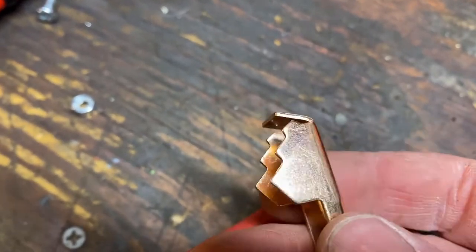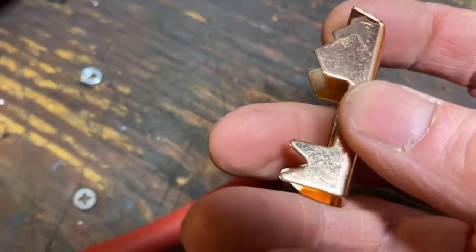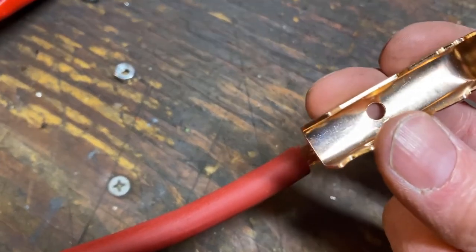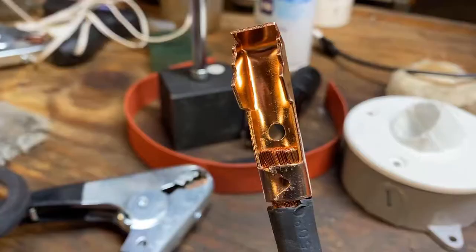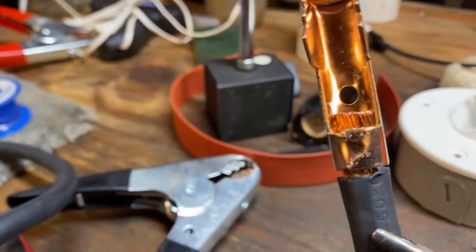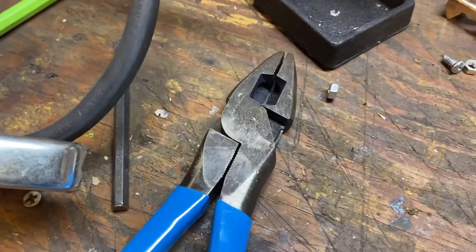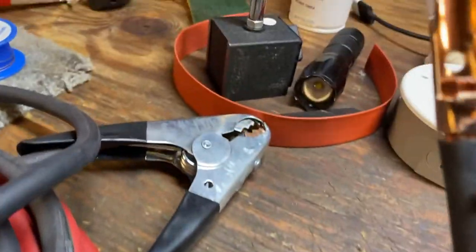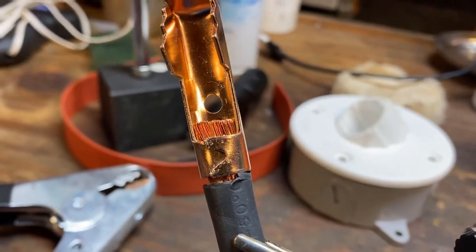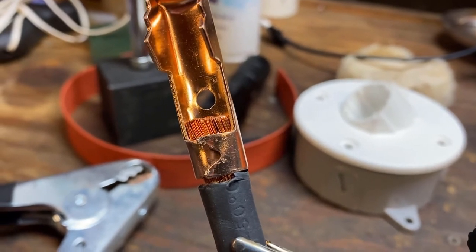Now these have a very, very thin coating of copper on them. When this thing heats up, that copper plating is more than likely going to come off — I saw the same thing on the negative side. I would rather have that solder bond in addition to the mechanical clamp. Here's what it should look like before you actually solder it. If you don't have the ability to solder, if you crimp it down the right way with a pair of lineman's pliers it will make a very solid connection. However, I'm going to put a little bit of solder on that using a torch, because your regular soldering iron just is not going to cut it.